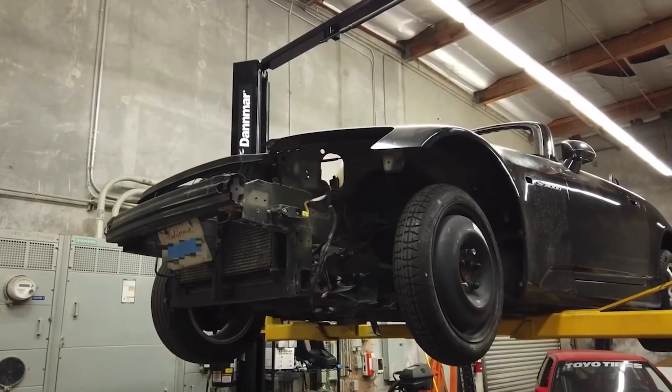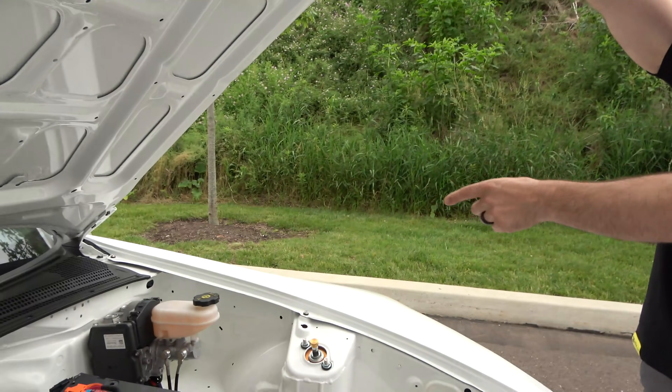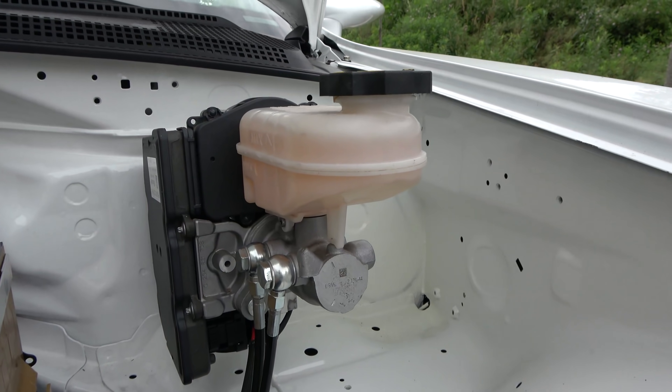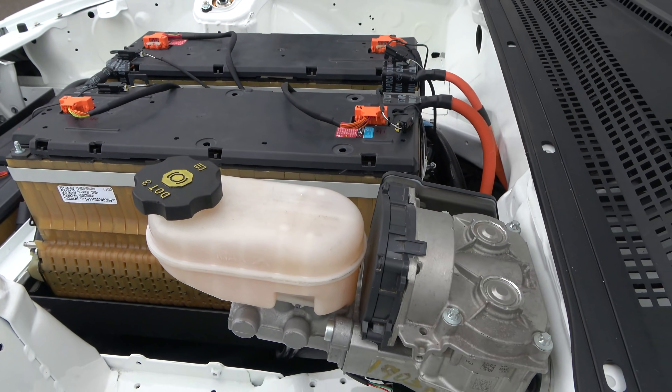I'm pretty confident range will be upwards of 140 miles when driving easy. There'll be a sweet spot — at certain speeds you'll notice efficiency, but when you wind it out you're pulling a lot more juice, and launching hard from a stop will drain it fast. For braking, I'm using an iBooster — sourced from a Tesla, though some Honda CRVs have them too. It's an electric motor-driven brake assist. Since I have no engine, I have no vacuum for a traditional booster, and rather than use a vacuum pump, I wanted to figure out the iBooster system properly.